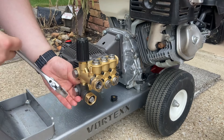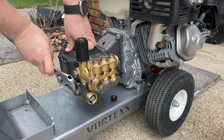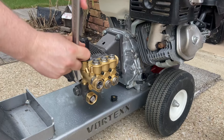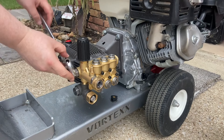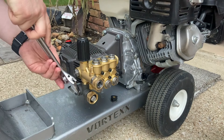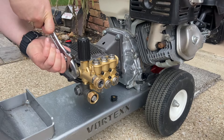I'll start them by hand first — that one started. Both have started now. These are a different size so the bottom one is a little bigger. The set I have access to only went up to 19 millimeters, and I believe these are metric since typically the pumps are metric except for the shaft. I'm tightening these both a little at a time so they go in pretty even. It doesn't have to be perfect, but I don't want a huge difference between the top and the bottom.